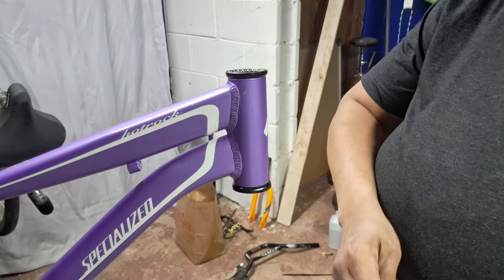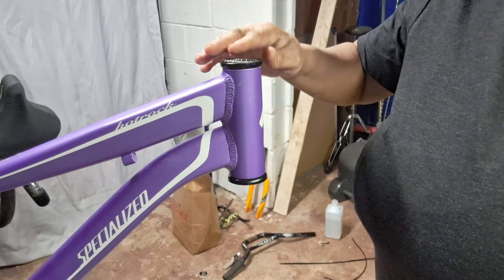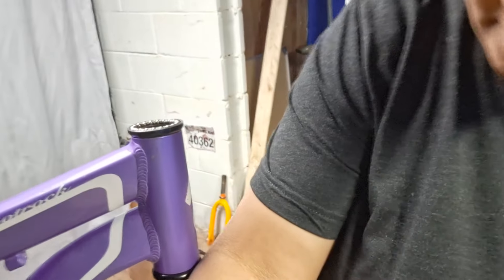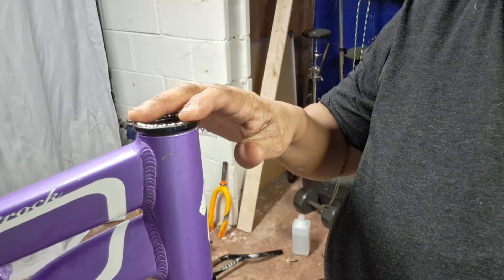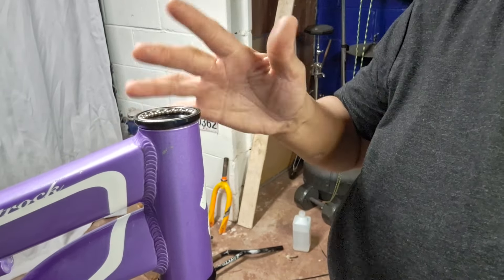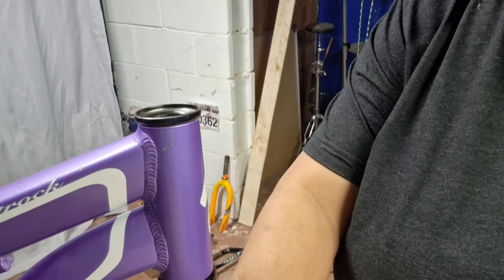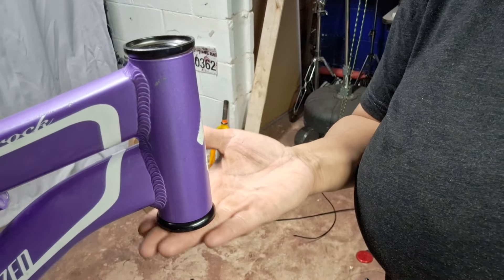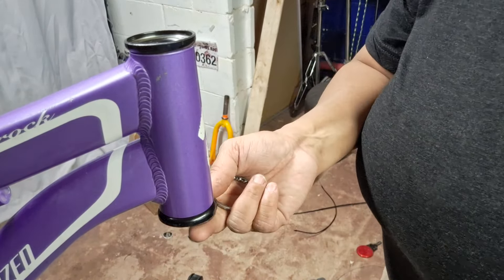When testing it, let's look at the top one. You can put it in one way and you see how it kind of sits with some wobble and it kind of sticks up. But if you put it the other way, it sits flush and it just seems to fit a little bit better — so that's the way it's supposed to go. And the same thing with the bottom: you want the rounded part to go up so that this part is flat and flush. When putting the bearings on, you want to orient them that way.